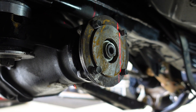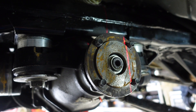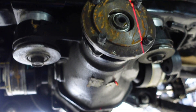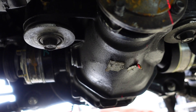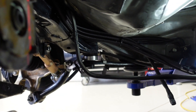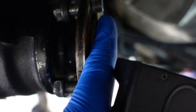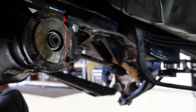We're looking at the front of the rear diff. You can see the laser level giving us our centerline of the car. It's normal for a hypoid diff to have the pinion offset from the centerline — that's just how they're arranged sitting on the side of the crown wheel. We've set the car up on the hoist so this face is vertical, giving us a reference. That means we can match the same angle on the back of the transmission to avoid vibrations from having the universals on the tail shaft at different angles.